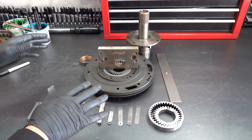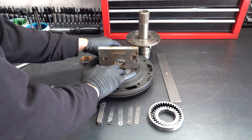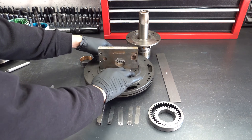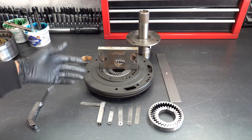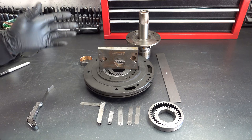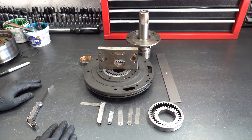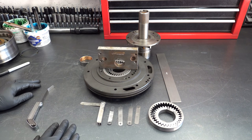Next I'll go ahead and come with my straight edge and do the same thing. The gears should go all the way around one complete circuit without coming into contact with the straight edge. I found this tool in my press tooling drawer — I'm not entirely sure what it's originally for, maybe some sort of jig for precision tooling — but I miked it and it's perfectly straight all the way across, so it works for this.